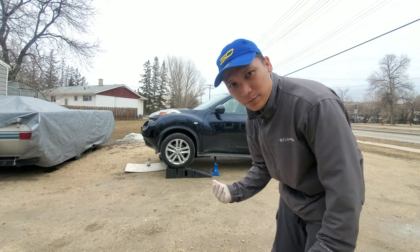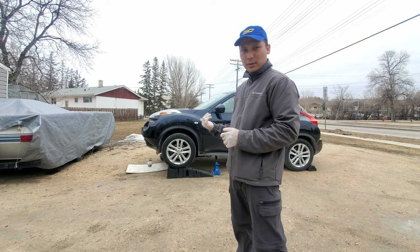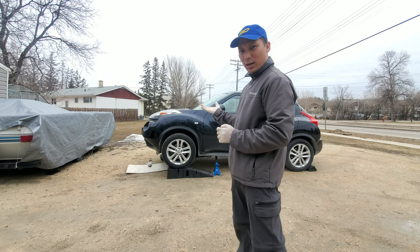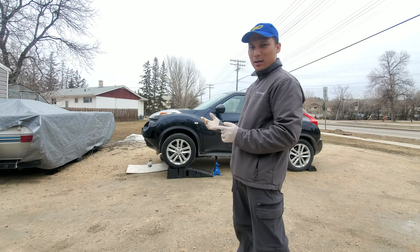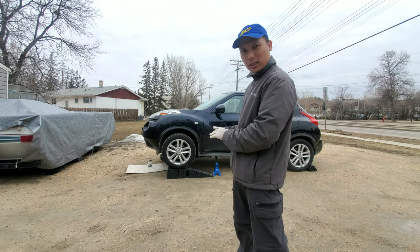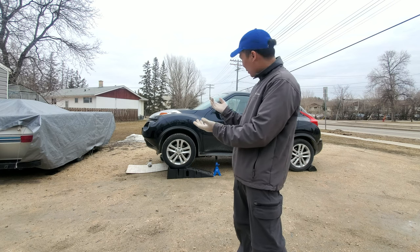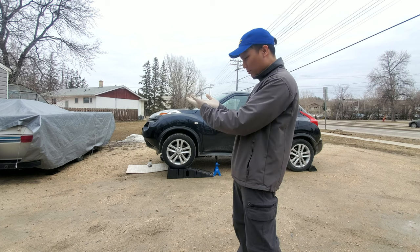We saw the clearance — as I said it's 17 inches, so it's the clearance that I want. This is a better way to do an oil change. I used to do it without the ramp. It's risky because when the ramp gets damaged, you have a chance of being pressed by your car. But since I have this jack stand, I might as well put it there for your own safety. This position makes the oil compartment go up, maybe 40 degrees.